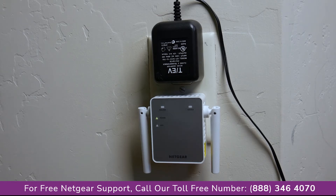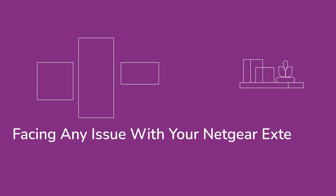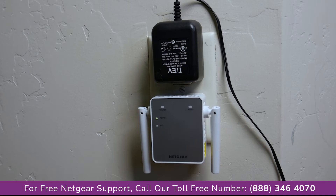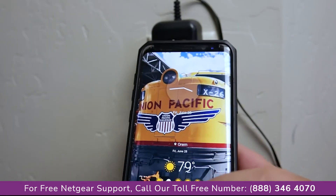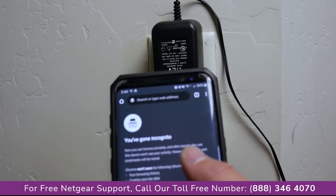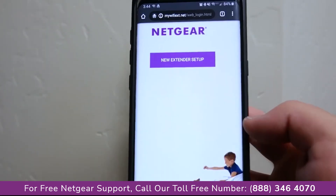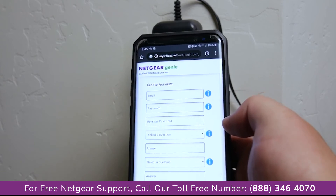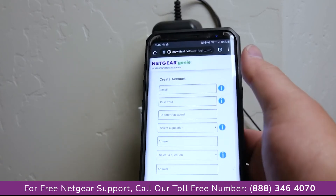For the web browser setup, use a Wi-Fi network manager on a computer or Wi-Fi device to find and connect to the Netgear EXT SSID Wi-Fi network. After the connection is established, the device link LEDs light up. Then launch a web browser and enter www.mywifiext.net in the address bar. I've launched an incognito window and navigated to mywifiext.net, which takes us to the Netgear website for new extender setup. It does want you to create or sign into a Netgear Genie account, so go ahead and fill that in.